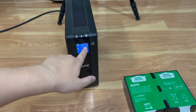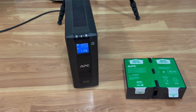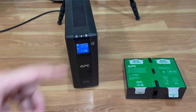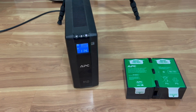The battery is low so it's just charging right now — there's nothing plugged into the UPS at the moment. Instead of buying a new UPS just buy the battery; it's a lot cheaper. I'll put links below for both the 9 amp-hour Pro 1500 battery — which also works in the Pro 1000 — and the standard one. A lot of people toss the UPS when they hear it die, but it's way better to just replace the battery. Always stick with the brand battery, not a third-party aftermarket one, and you'll get the standard warranty too.